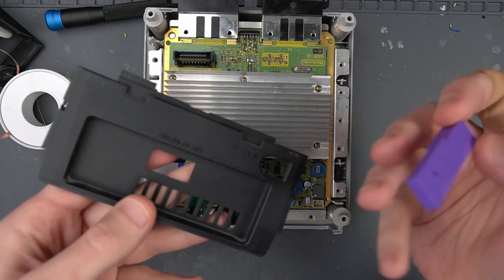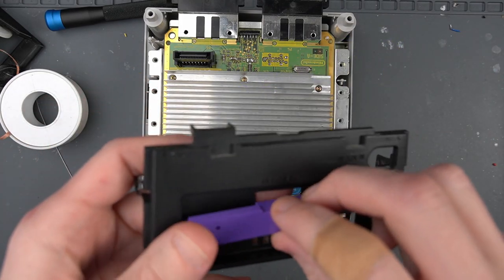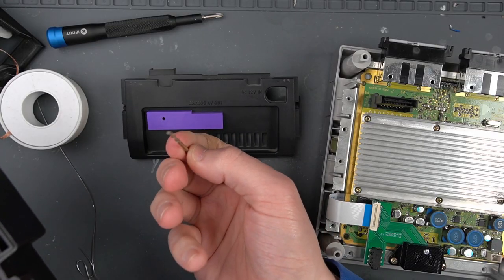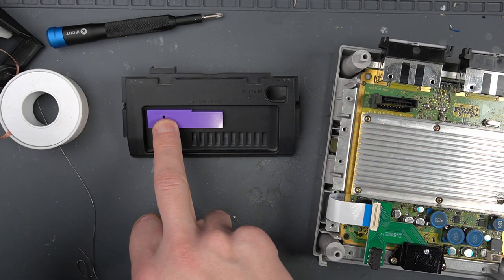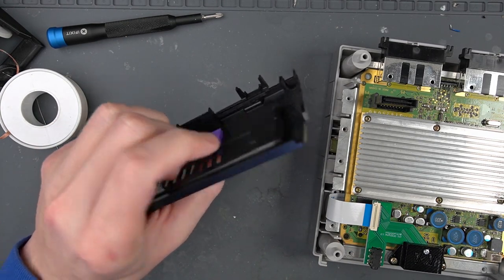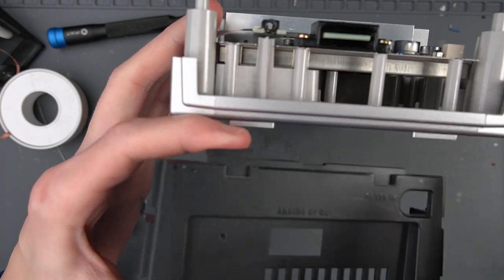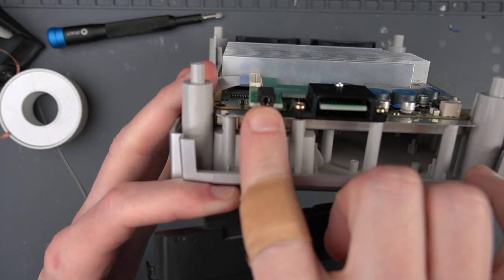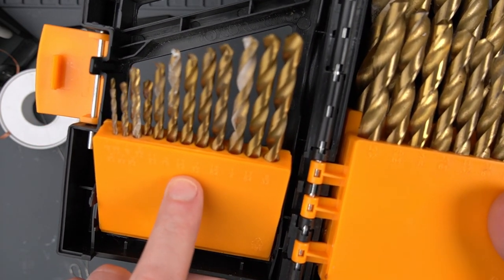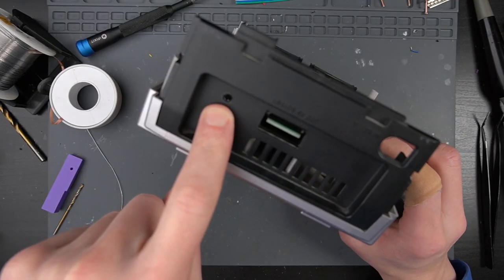You'll have this drill block piece for drilling out the audio port in the back shield. Put the big part into the analog port slot on the back shield and drill a small pilot hole here — this isn't going to be the final size, just a pre-drill so we can use the larger bit afterwards. Just be careful not to put your finger where the hole is going to be. Dan said the 3/16-inch drill bit is just barely too small, so go to the next biggest, which is 13/64ths — and yes, that seems to be just perfect.